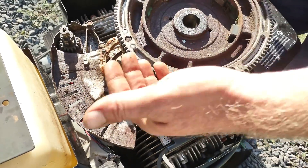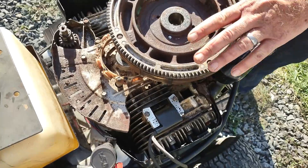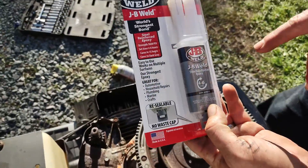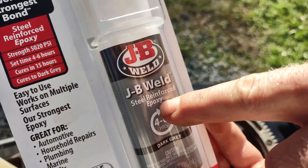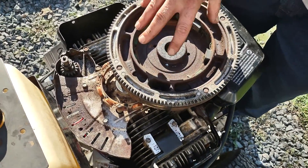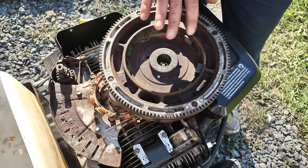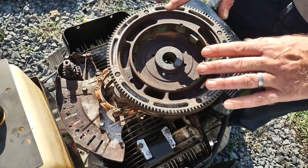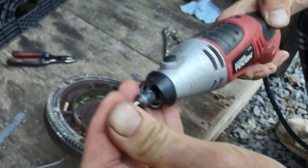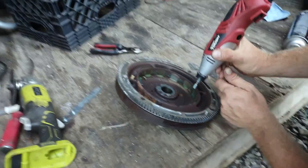So you've got it all off, got your stator replaced, but your flywheel looks destroyed — but it's not. What you're going to do is buy JB Weld steel reinforced epoxy. This is how we're going to get our magnets back on. A guy showed me on YouTube and there is another video on how to do this, but he did it in a way that's way harder than it has to be. You need a Dremel with a grinding bit on it.